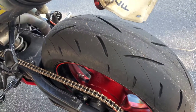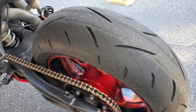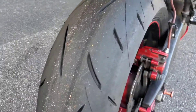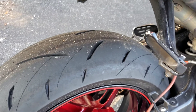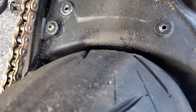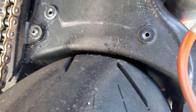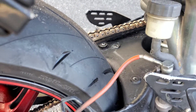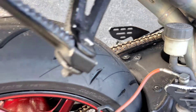Have you noticed a line going down the middle of it? That was caused because I went up to a 200 size tire, 255, and then I got a new chain. If you notice, there was not a lot of space in between. And with the new chain being a little tighter than the old chain, it was rubbing on the swing arm, which caused a problem.